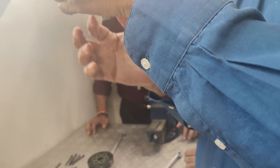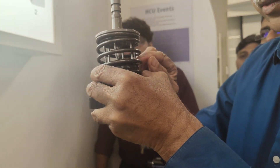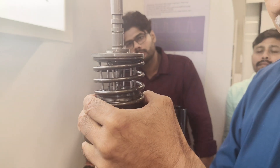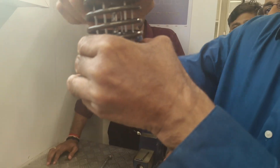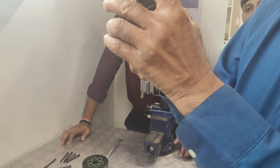Just slightly tighten and then turn this so that they start going in the holes — they pull the hole slightly. I am only touching it, I am not compressing it, but not too much. If it is too much then it will get stuck and you will bend the plungers. See how fast it has gone in place.